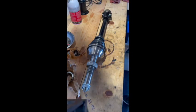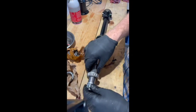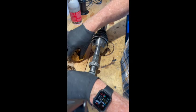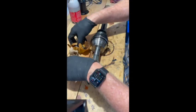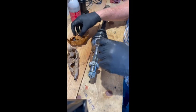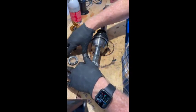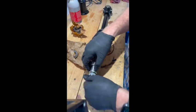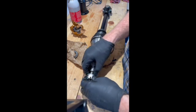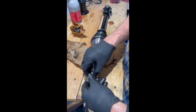Now back at the workbench. This is the new axle. I've already taken one of the bearings out here just to see which set fits where. If you buy the same kit I did — literally guys, it was under a hundred bucks — they'll send you bearings packed like this. I received two bearings that are the smaller diameter and two that are the larger diameter, as expected. It comes with castle nut and washer as well. It does not come with a cotter pin, so the one I have looks pretty good — we're going to reuse it.